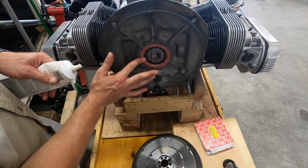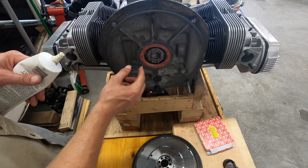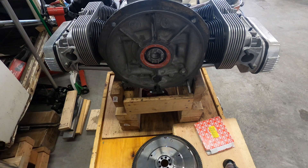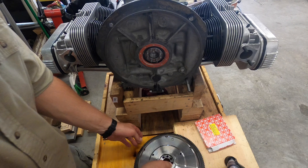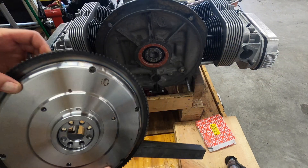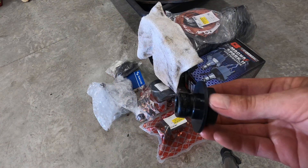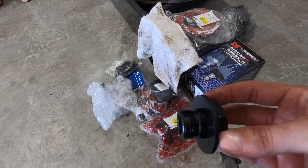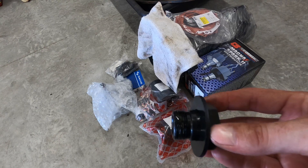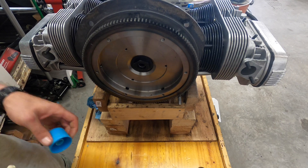Now I'm just gonna double-check my end play — if it's off bad enough I'd have to take this back out to get my washers out, so that would be a bad day. One more thing I almost forgot: make sure you put your o-ring inside here — I've already lubed it up with some oil and put it in there. Make sure you do that before you stick the flywheel in for the final time. Clean off your threads and then put a bead of Loctite on there before you tighten this down. I'm gonna do 250 to start and then crank it down a little bit more — minimum I'd say 235.